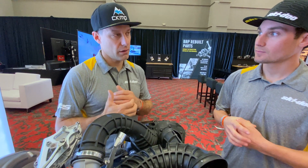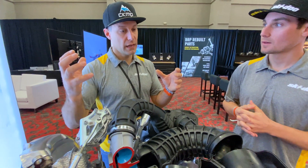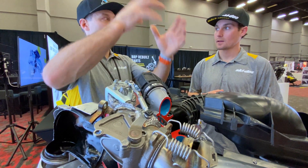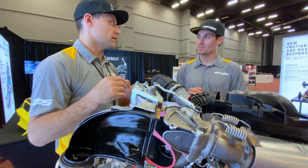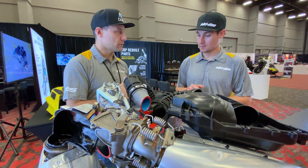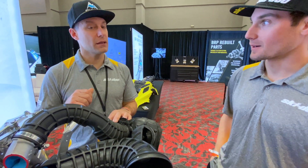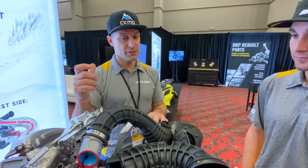You have this air moving through the airbox — it's a big mass. When you let off and the throttle plate closes, the air stops moving below but up in the intake track it's still moving. It's vibrating in the airbox and can't get through the impeller because the throttle plate is closed. That's why it vibrates and just sheds all the snow off the intake, which is actually a pretty handy tool, especially riding in crappy fog or icing conditions.